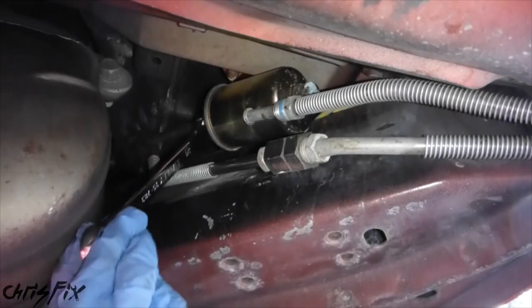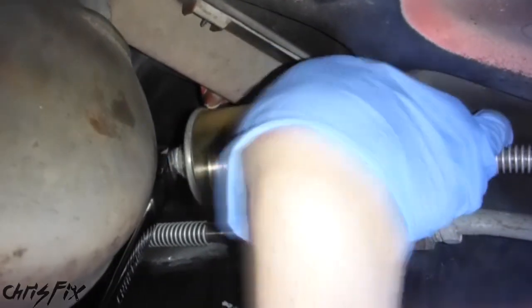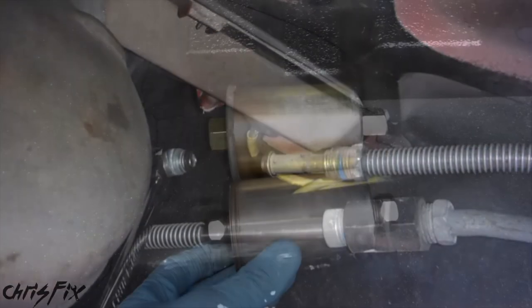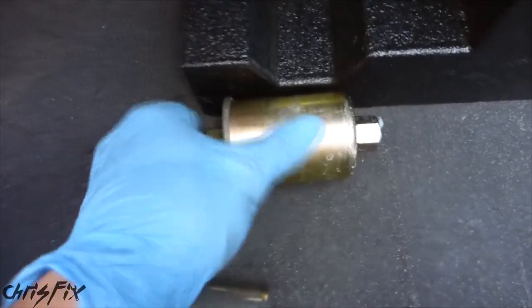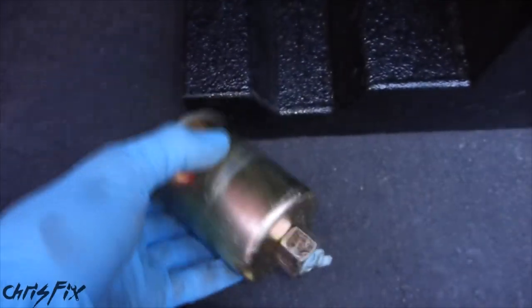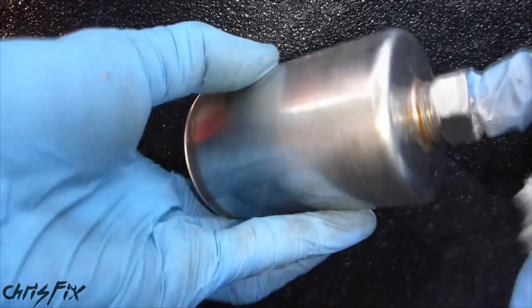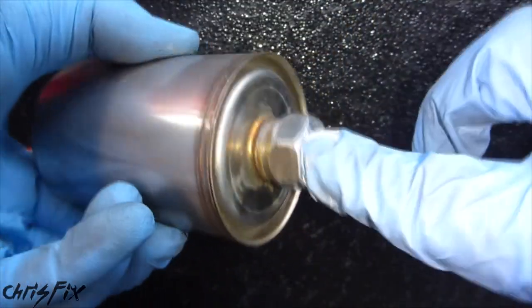Once you break it free, you can keep the wrench on the flare nut in the back as you turn the filter, since there's way more room to turn the filter than the wrench. And there we go — that's our old filter and this is the new one. Always compare your parts and make sure they're the same. If you look at the threads on the old one, you can see after 30,000 miles there's some corrosion which made it hard to come off. So what we're going to do is get some anti-seize on your finger, get some right in there and on the other side, and rub it into the threads — this will make it a lot easier to get off in the future.